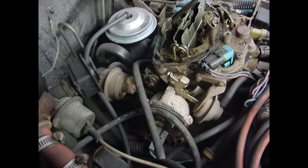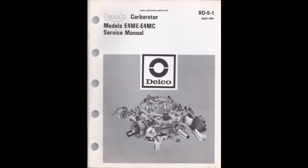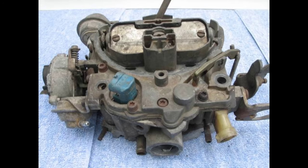The electronic feedback carburetor's primary purpose was to help control tailpipe emissions. As built, there really wasn't a benefit when it came to fuel consumption. The sole purpose of the carburetor was to maintain an air-fuel ratio of 14.7 parts air to one part fuel throughout the full range of driving conditions whenever possible. This ratio had to be maintained because it allowed the catalytic converter to do its best possible job. It worked in conjunction with GM's Computer Command Control System and the ECU, which was the brain of it. The system contained several sensors including a MAP sensor, coolant temperature sensor, and the throttle position sensor located inside the carburetor, amongst others.